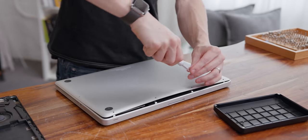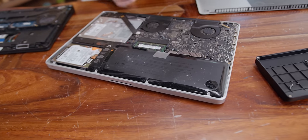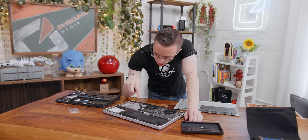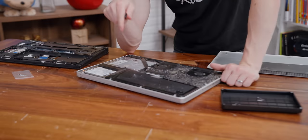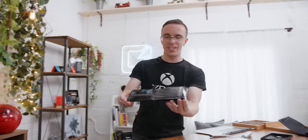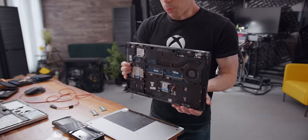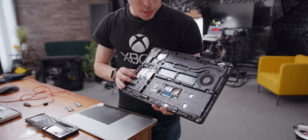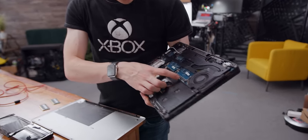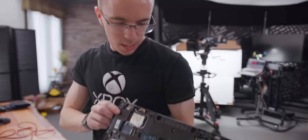Here goes nothing. I wonder what happened — the way it looks like, the battery expanded and I bet it pushed the trackpad out. I don't even want to touch that thing. When it comes to the Dell, even though it's missing so many components, for our project we can actually turn this thing back to life pretty easily. All we do is grab a couple of SODIMM modules, DDR4, grab an SSD — even like a 240 gig SSD — and plug this guy into Ethernet, and we have what should be a usable desktop. But the MacBook, I think the MacBook is going to be the trickier thing.